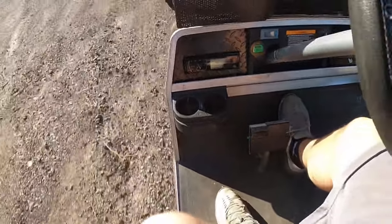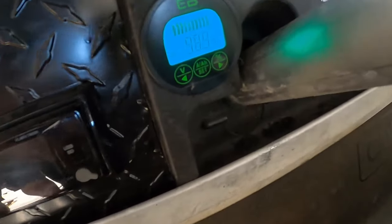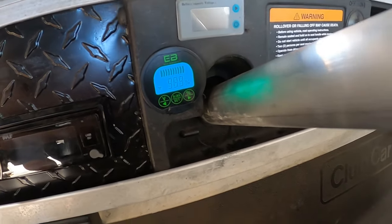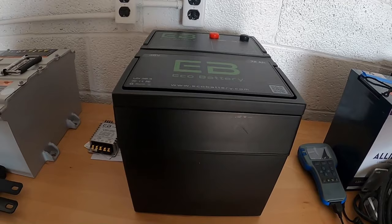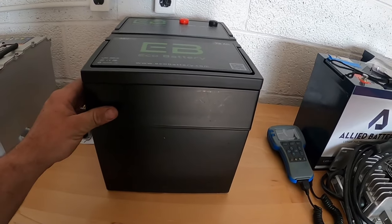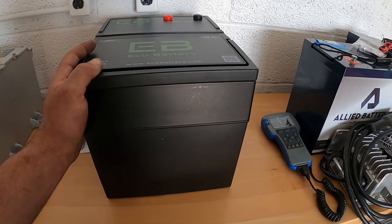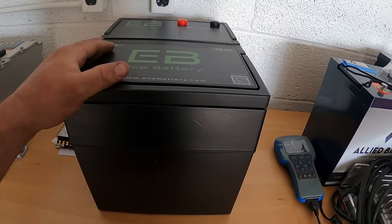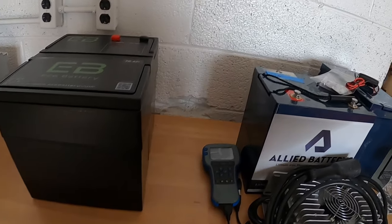Let's test it out. Good amount of pickup — not enough to spin the tires, but noticeably better. There's the gauge display: 99.89 percent, solid on battery. Important note: this DS had six eight volt batteries rather than four 12 volt batteries, so the tray is different. We sent Eco Battery some measurements and hopefully they'll work on designing something different for that setup.